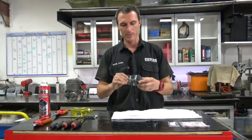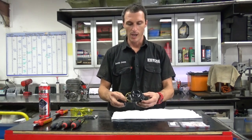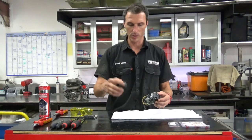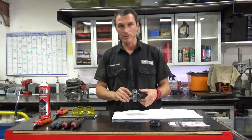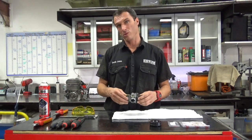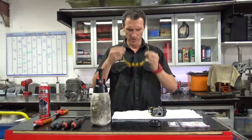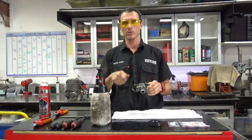The carburetor comes like this, or with the airbox adapter already screwed onto it. Normally I'd just drop a Loctite and that will keep that on. This carburetor here is not so dirty but we're going to use a little bit of solvent or carburetor cleaner to wash off and loosen any dirt off the outside, then blow it off with some compressed air. Make sure you're wearing your safety equipment when using solvents and compressed air.